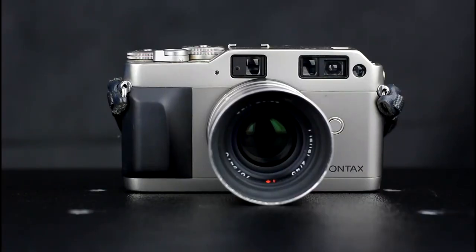The autofocus performance of the camera, once updated to the green label standard, has its limitations, and steps need to be taken to minimise the number of out-of-focus shots taken. There is an additional manual of useful hints on focusing the lens that were supplied with the camera. In single-shot drive mode, the camera will not fire if it has not been able to focus.